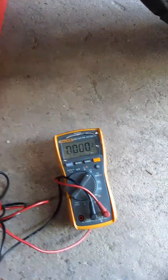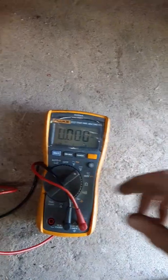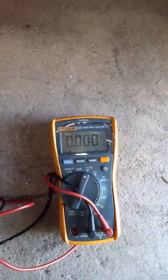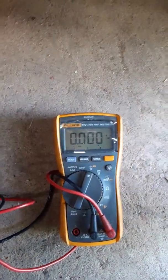I've got those two hooked up to a good reliable voltmeter, and when I spin it — I get nothing. I'm actually checking it on both AC and DC just to make sure, and I'm not getting any kind of signal at all whatsoever. Looks like I'm going to go order myself a speed sensor.